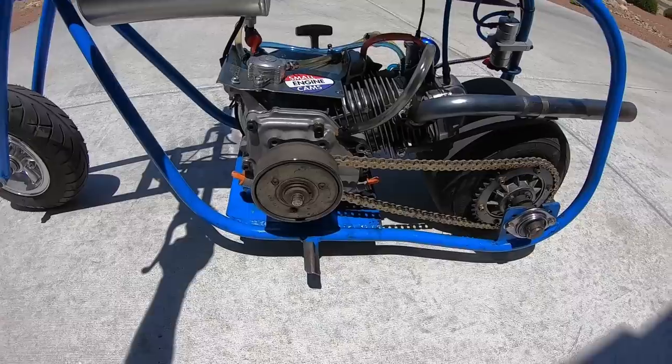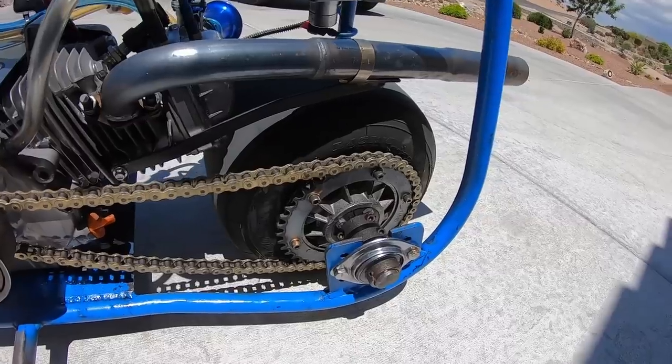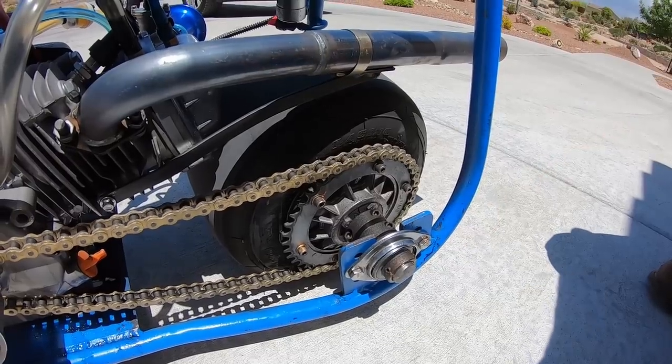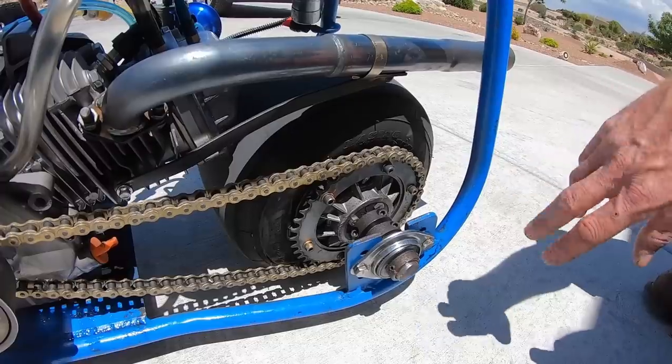I tried a different hub assembly. That's one of the old Azusa Engineering Mark V Vary hubs on the back. That you can move back and forth really easily. It uses a wedge design here for the center hub, and that's how they're basically sandwiched together, and it clamps the axle shaft really tight.